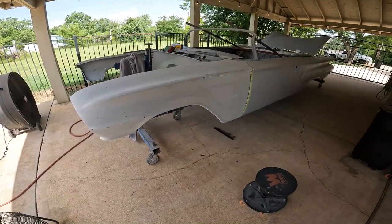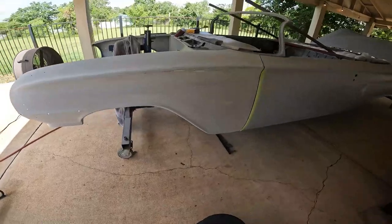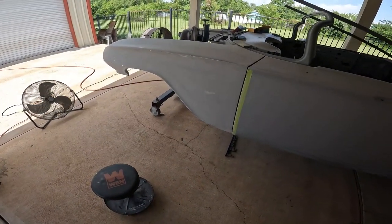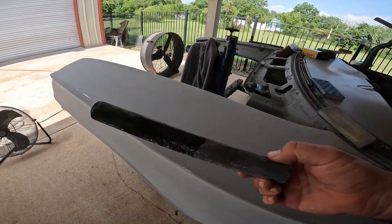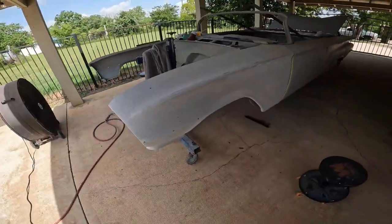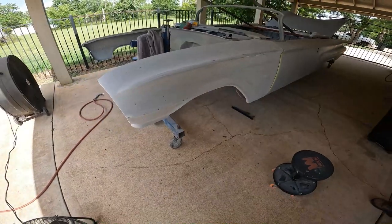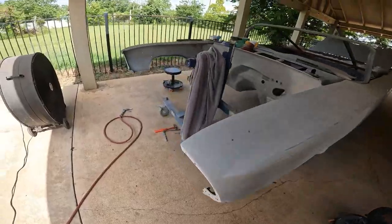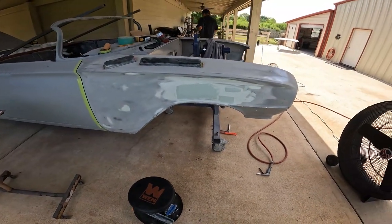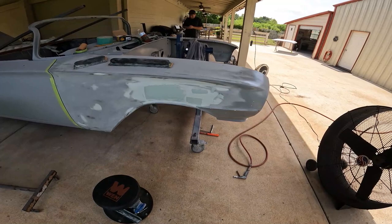Here we are, it's almost 11, and this fender blocked down really good. I'm liking it - it almost doesn't need the polyester primer. So it's in 180. We used the Dura-Block round blocks and the Black Diamonds, and then some by hand. We're going to get this thing on a stand, re-epoxy it because we do have some bare metal, and then we'll come back with the feather fill. I don't even think it needs feather fill, but just to get everything uniform. This one over here I'm about to do this last round of blocking - it's a little bit more work. Going to hit it with the 180, but it's coming along.